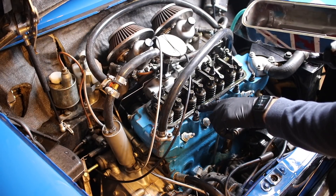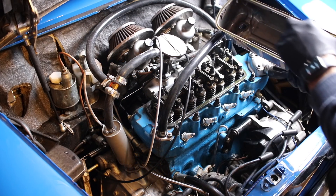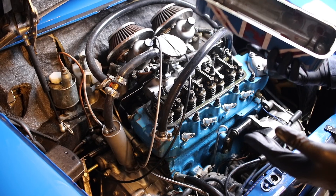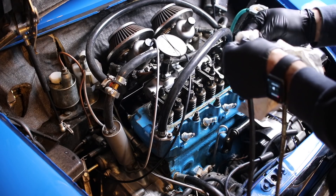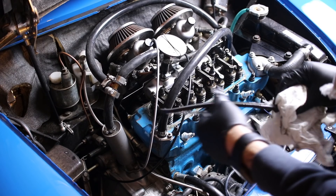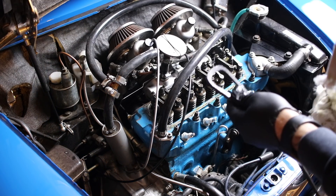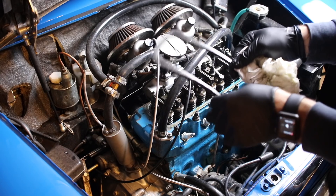As you can see around the seam here, I was losing oil. You can kind of see it around the edge of this as well — sorry, the light's not very good, but you can see it around the edge. And that was my problem. Now, like I said before, this gasket actually isn't bad — it could be reused. Next time I'd probably put some gasket sealer on it to help it seal a little bit stronger. But for right now, to make sure that stuff seals back up, I'm going to set this aside and put a new gasket on.